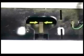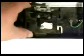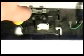This is a lid switch actuator, and it goes between the lid switch and the check switch. Insert the lid switch assembly tabs into the slots in the cabinet and align it. Screw in the holding screw just tight enough that you can move the lid switch assembly forward.